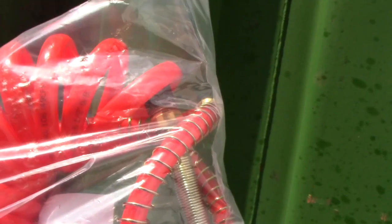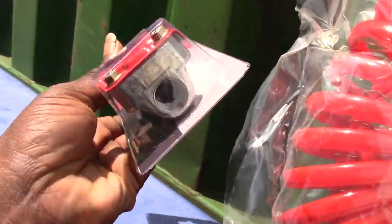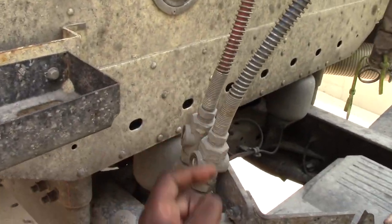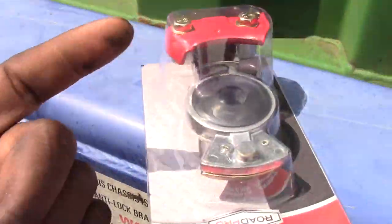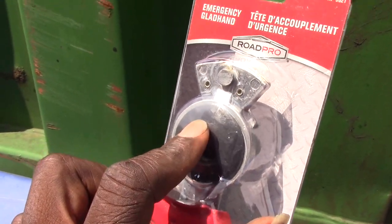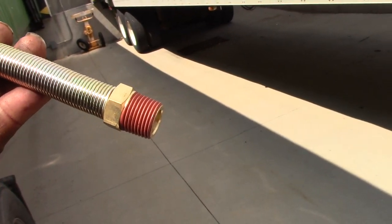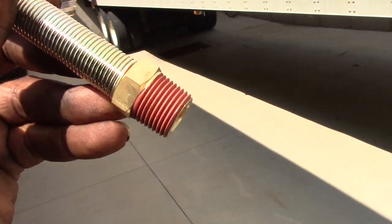Yeah, I grabbed it from my truck stop. The arm right here and then it all connects down here — here's the glad hand arm. I'm gonna put it on here, then I'm gonna connect this side right here. Put the rubber gasket in there, put grease all around there, take this with your hand over like a little spatula, put it all around there. Put it on — that seals air. So if you got an air leak from right here where the air connects, grease will do the job. And you can see this little red stuff on here — it's thread tape already on there. But I'm putting my own thread tape on there before I put it on.